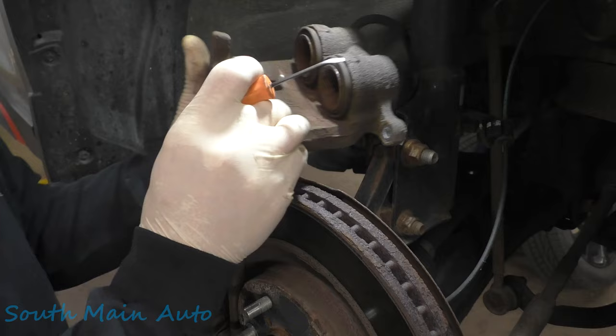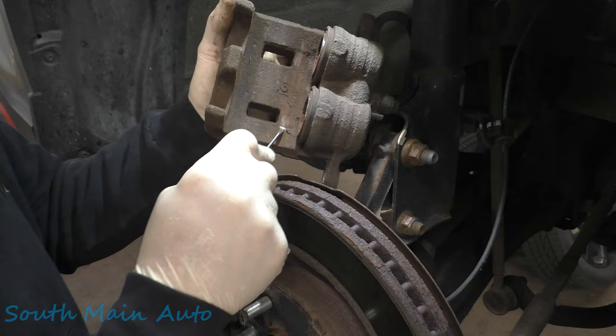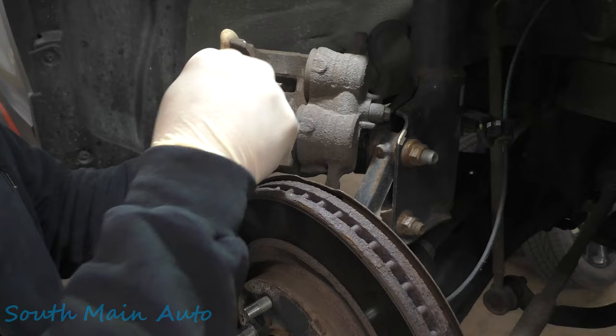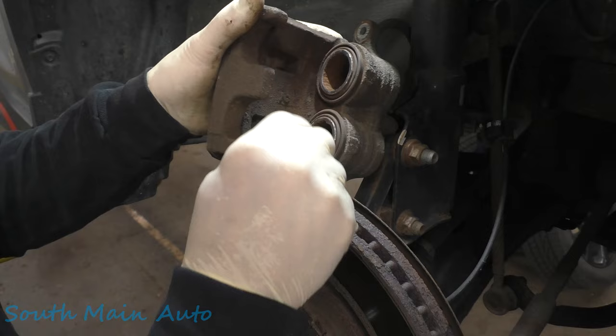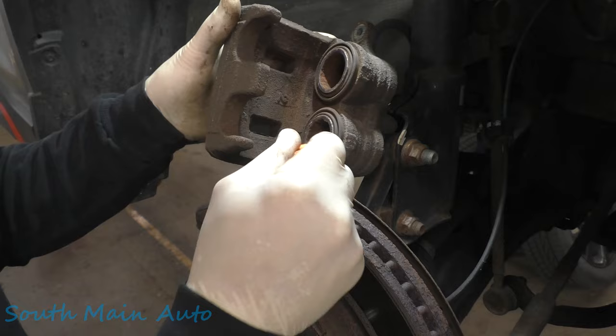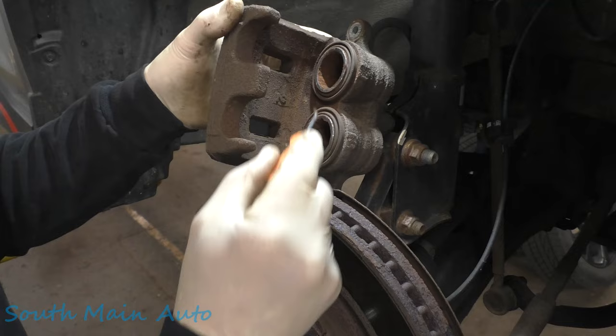You can see where the rust on the rotor was hitting the caliper — got a few shiny spots. Now I'll just come in here with a stiff wire brush, knock some of the big junk off, hit it with a blow nozzle. You'll get about one brake job out of a set of calipers on a Subaru in the northeast, because what will happen is these pistons will rust through and then they'll start leaking brake fluid. You can see the amount of really heavy scale that builds up inside of them — eventually they rust right straight through.